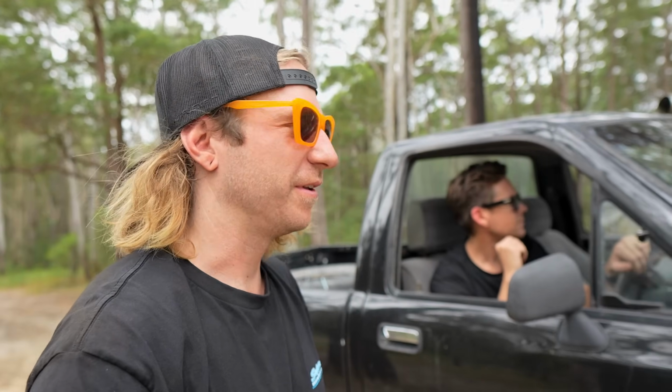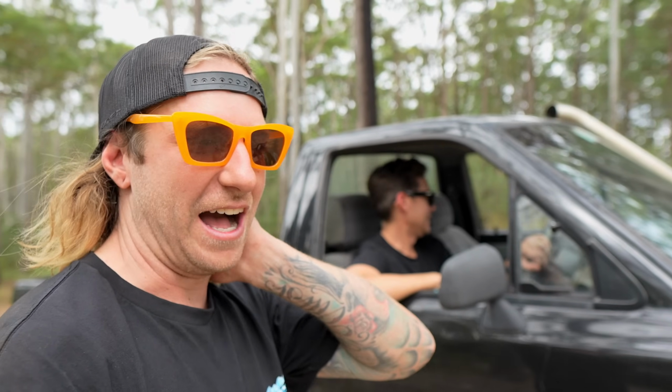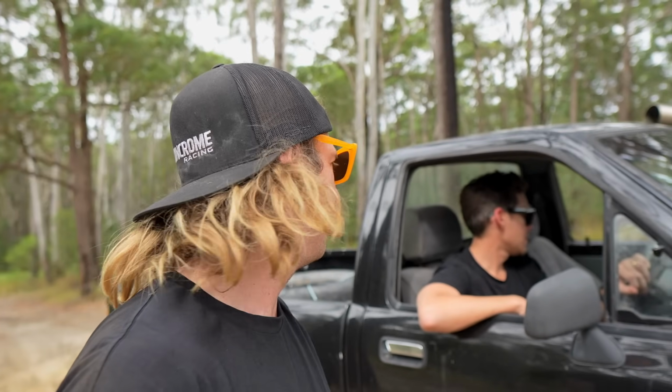Well, this is why we come to the test track. So we've found issue number 1. It's rear wheel drive. The hubs, you can just hear them, they must be stripped out in the front because it's just going tail shaft spinning and the wheels aren't. It might be grabbing a little bit, but as soon as it's under pressure, it sounded like it was just chewing out. More parts to order. We'll see what we can do until we drive over here, eh?